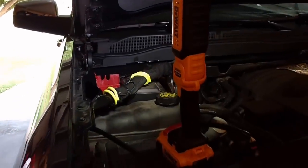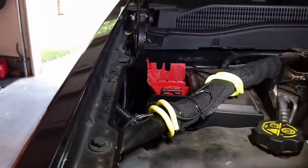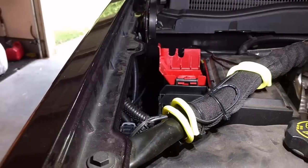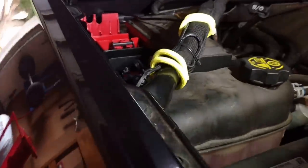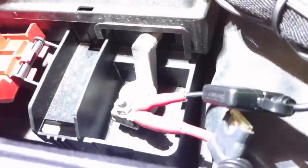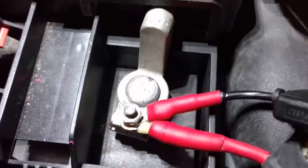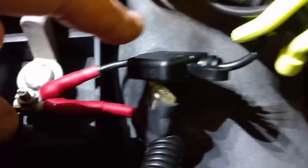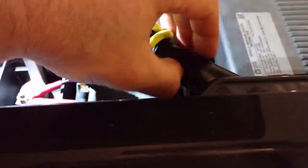Let's take a look underneath the hood. As you can see, the wire is in the split loom there. This is right on the positive terminal of the Chevrolet's OEM battery, and I used 10-12 heat-shrinkable eyelet crimps on there. There's a 25-amp fuse in there, ATC style. This other one here is for my battery tender junior with an SAE connector.